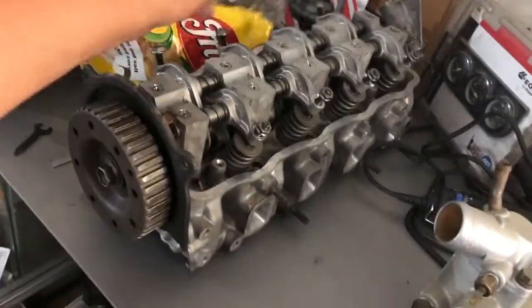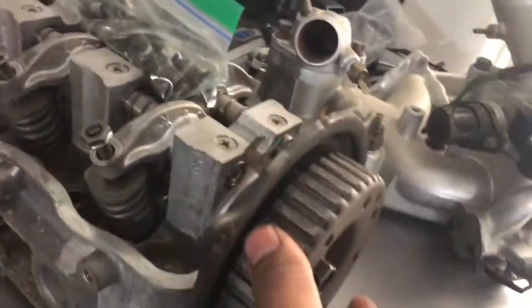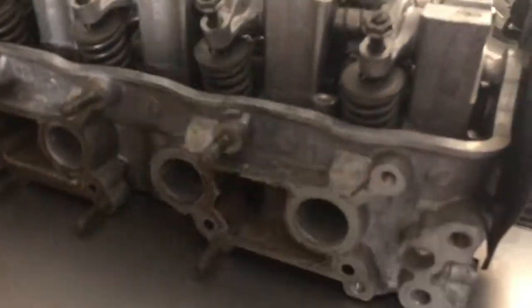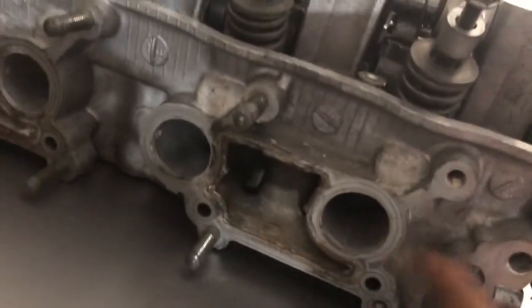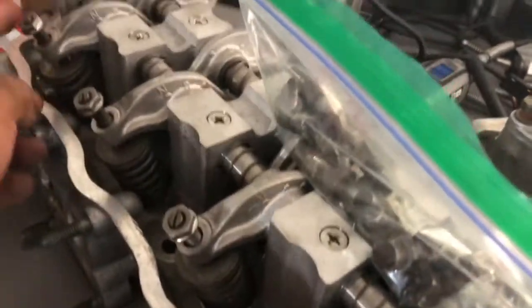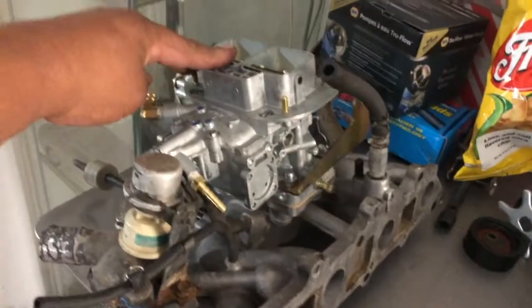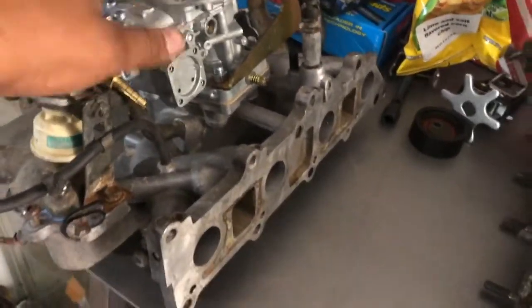Here we are inside my garage workshop. This is my buddy's Suzuki Samurai engine head - while I had it out I ported all this, this is the exhaust side. I gasket-matched the intake side, it was pretty close, maybe sixteenths off so I just left it. I put in new valve seals, I gotta readjust all these but he's in no rush. Also throwing in a 38/38 Weber - some people say it's too big, some say it's fine, I guess we'll find out.